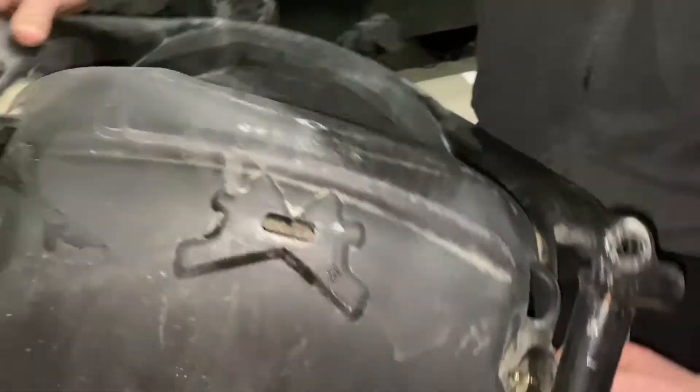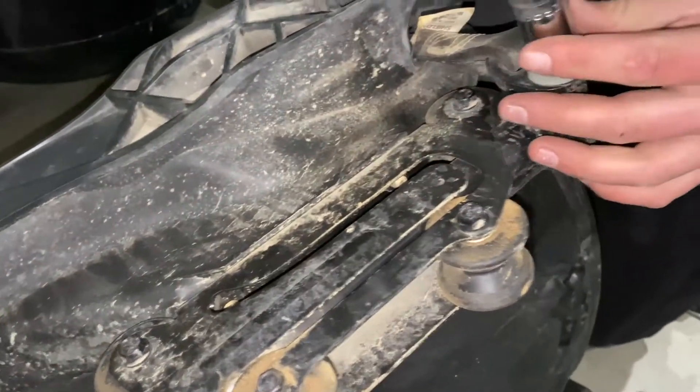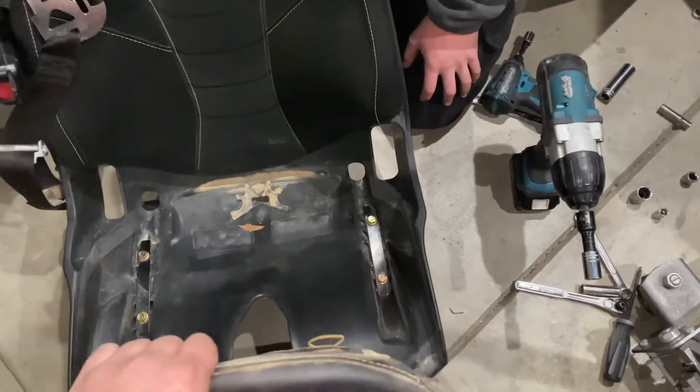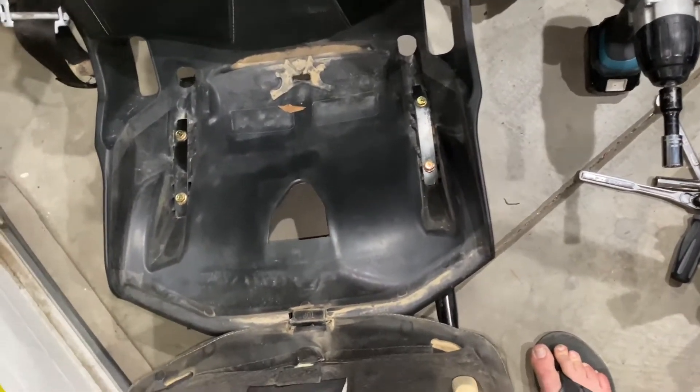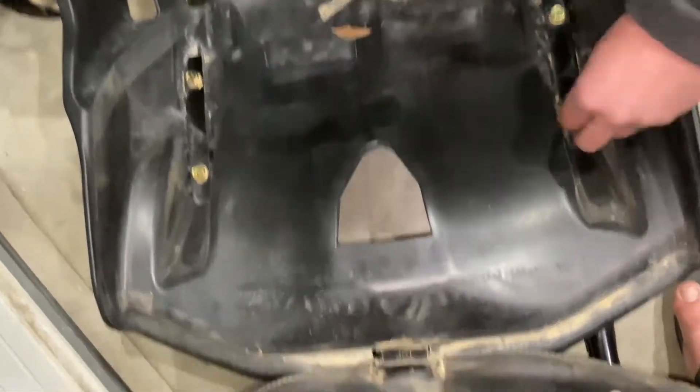So we're going to take these seat belts off. The way we do that is you open up this latch here — there are four bolts that stick up. These are the stock seats and we're going to get them into some good cushion seats. They're pretty bad. You just take these off, then the factory mounting brackets at the bottom just come off and then we'll attach them to the new seats.